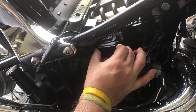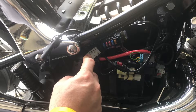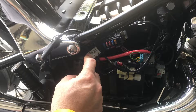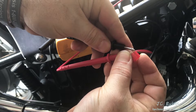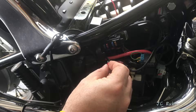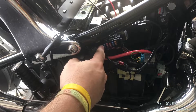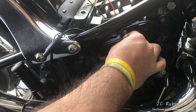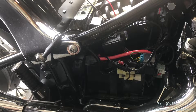While we're down here, pop this open. We can see there's a fuse labeled as ignition — if that fuse is broken you have no ignition. Pull it out and have a look. Do a visual inspection or put your meter on diode mode. If the fuse is bad, replace it and button everything up — you may have just gotten lucky and your ignition may work. If that fuse is good, take this opportunity to check all the other fuses. A bad fuse elsewhere could be affecting the ignition as well — the ignition goes through more than one fuse. There's also a main fuse.